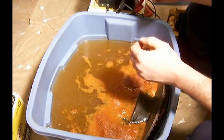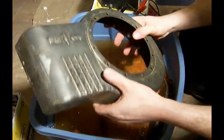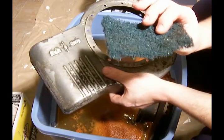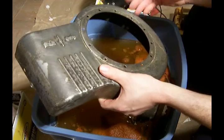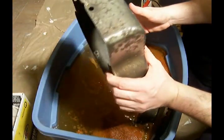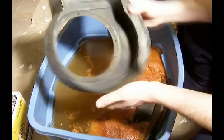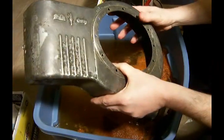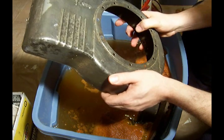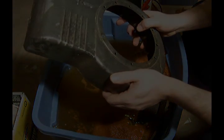One last little bit to this video. I took this piece of rusty metal out of the soup and brought it up into my wife's kitchen sink. Using one of these paint-removing scratch pads that you can get at a hardware store — look in the paint department — I scrubbed this down. Took off the rest of the paint very easily, as a matter of fact, cleaned it up, and dried it. Now it's not perfect, but this engine is from 1955, and this is good enough. A little bit of primer on here, and then when I choose the color, this will look sharp once again.